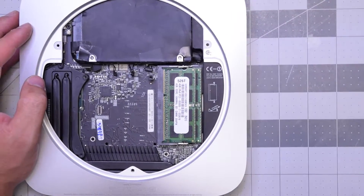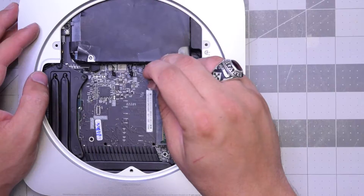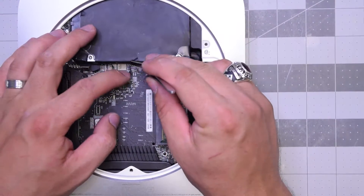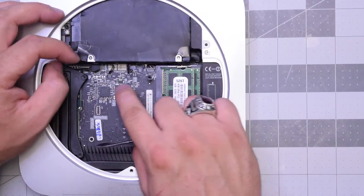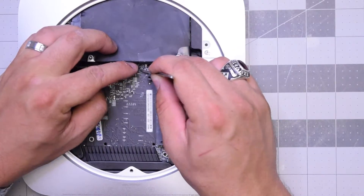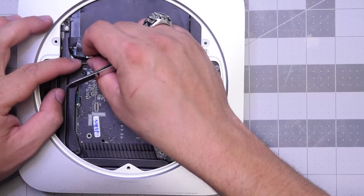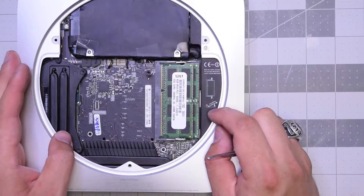Make sure to pull out any cables if they're jammed. There should be six connections — start with the first two ribbon cables, popping them into place, then the sensors from the hard drive and from the optical drive. Once those are in, plug in both the hard drive and the optical drive connections. Make sure you hear that click — they should be firmly in. Check all six connections before you proceed.